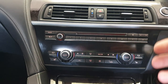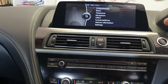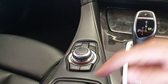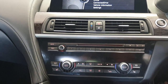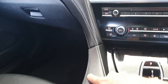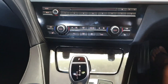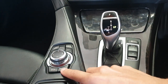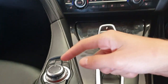Here's the challenge: after connecting everything up and switching the car on, it boots perfectly, the screen looks great, but the iDrive controller isn't working. The installation instructions actually neglect to mention that you have to connect the iDrive up to the T-harness connected to the CIC computer. That makes the install more complicated because you have to remove the wood trim around the shifter, remove the entire bolster piece, remove trim panels on both sides, and lift out the entire unit just to get to the little connector for the iDrive — where the original car harness plugs into the T-harness, and then the unit plugs into the iDrive controller.